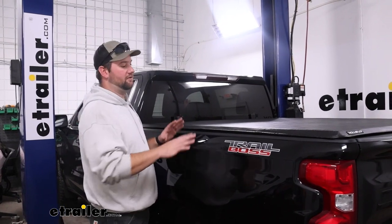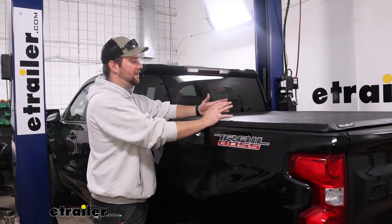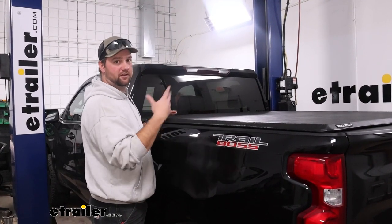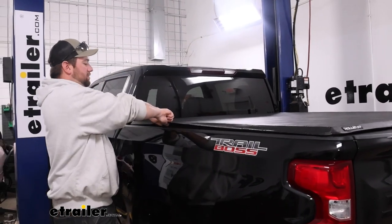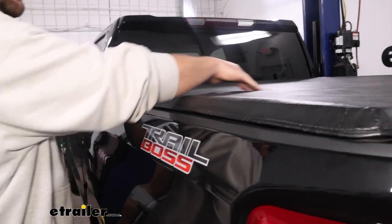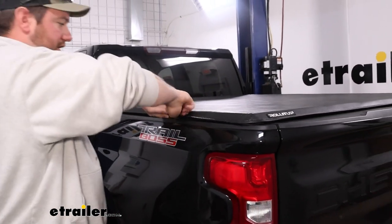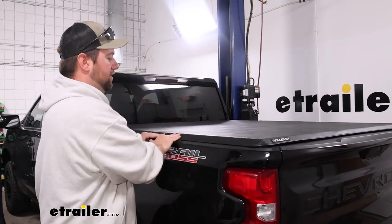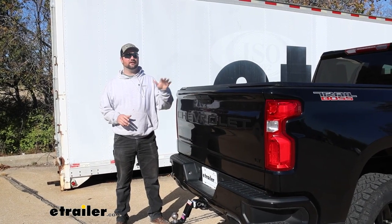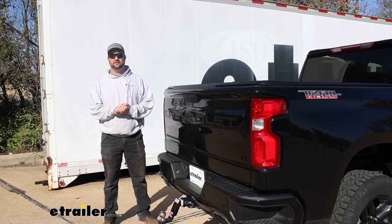The last thing you need to do — and in my personal opinion this is the most important step — whether your cover is brand new like ours or in the future when you're using yours, is to go along the edge and pull and tuck this vinyl so that you get all the waves out. If you start getting waves on your cover, you'll never get rid of them. The cover can only tighten up in the sun so much, so do that on both sides of the vehicle. After you get everything tightened down, that's going to do it for installation. Hopefully this video helped you decide whether or not the Lear Soft Roll-Up Tonneau Cover is right for you and your 2021 Chevrolet Silverado 1500.